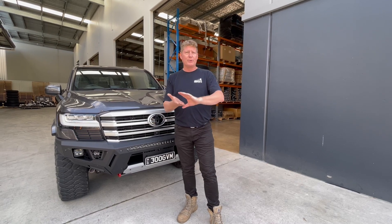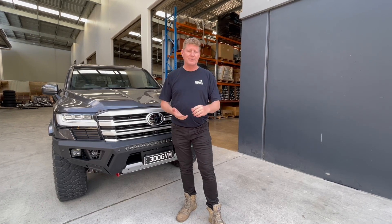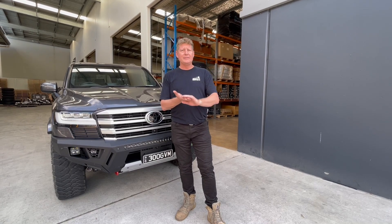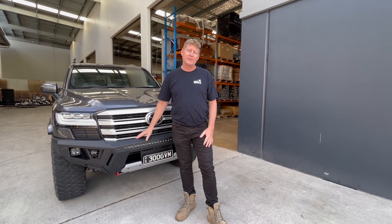Toyota already planned for four or five occupants at 63 kilos, a bull bar they supply from factory, side rails, and everything else going in the back. You need the actual capacity. The reality is you need 2600 to 2800 kilos of axle load to make a 4200 GVM work in a 300 Series. Thanks for joining us.